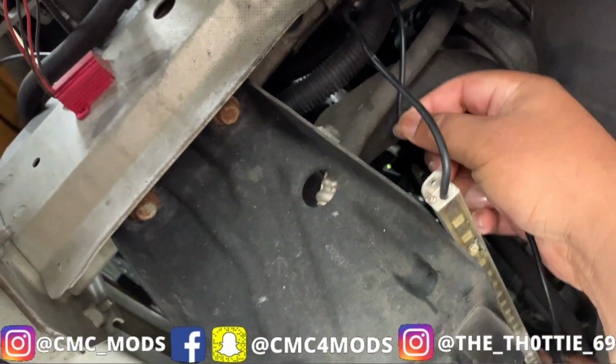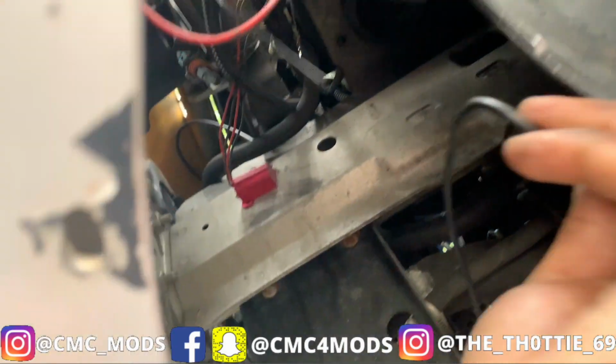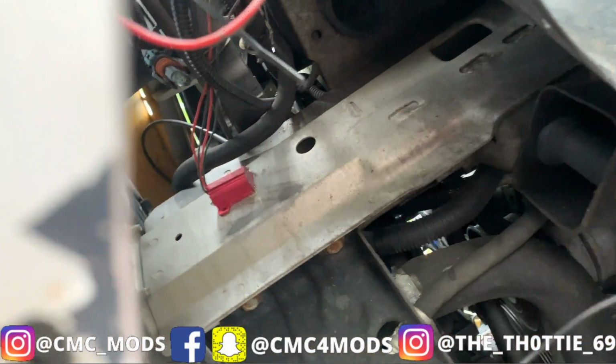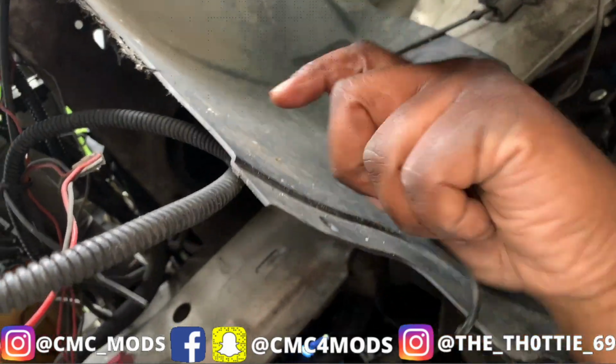Yes, I'm saying, but if you go around here, right? You see around this pole right here? It's gonna have it in the air because you're gonna loop back up like this, then go through this one and go to the back. But you don't want the wire to go here. You know why? You want it to be in here because this is the firewall. Yeah. This is the fender well. This comes over here, the tire is gonna chew it up.